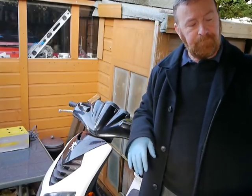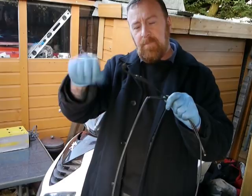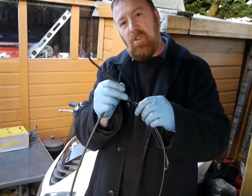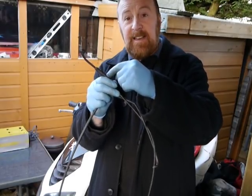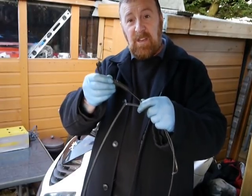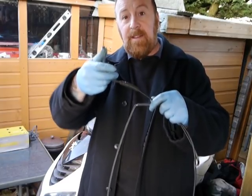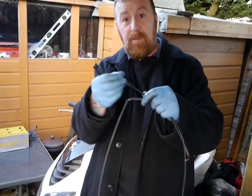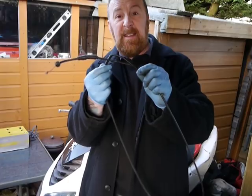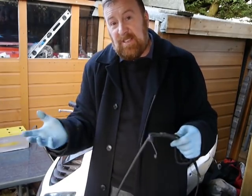Is this preventable? Well, yes. The Speedfight cable is not too bad, but this is where your problem starts — where it connects to the accelerator throttle twisty thingy, and here. This rubber here is quite nicely banded round, but on others they're a bit cheaper. What happens is water ingresses into here and goes down the cable, and it rusts. You can stop it by, when you first get the bike, taking it apart, making sure you get a good bit of entry in there, spray WD maintenance spray down there — lots and lots of it — as much as you can, opening and closing it. Then make sure you clamp them shut afterwards, so a good bit of electrical tape or whatever the rubber was there again. This will make sure it continually moves up and down like it's supposed to. Because what happens is water gets in there, or sometimes it's fitted badly, and then there's an opening, water gets in, and it will jam open. It can be very, very scary, or it can just snap, and then you're sitting there with a bike that won't rev up.